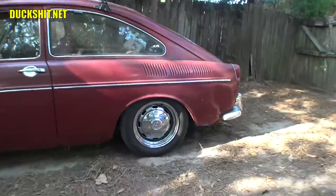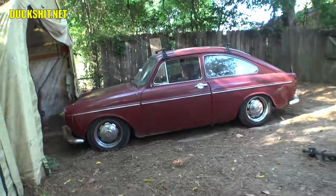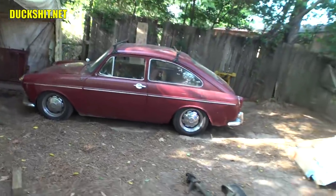After we tore Ruby apart and upgraded the rear end to an IRS rear suspension, I put it all back together and it just drove something terrible. It looked really cool down nice and low, but it just drove horribly — it was rough, it was bouncy, and it's not the kind of ride I'm used to on this vehicle. What we're doing today is trying to raise her up roughly about two and a half inches, just based on my calculations to where she needs to be.